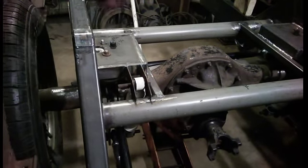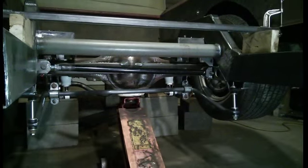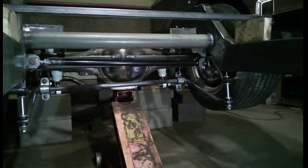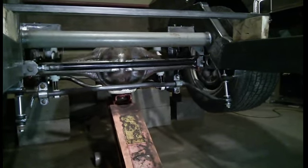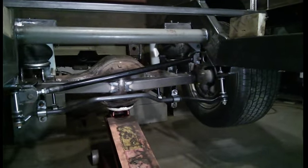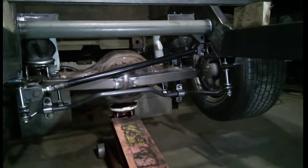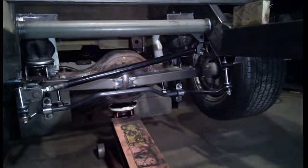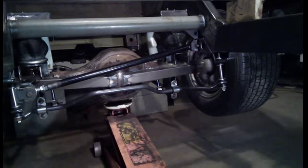So I'm going to have to do some more work. That'll all get cut — same with over there. I'm just checking clearances on everything with the rear end all the way up, then I let it down. I had two inches of up travel and short of four inches down travel — about three and three-quarter inches. The most I'm allowed to stretch that bag is nine inches, and it's at eight and three-quarter right now, with the shocks holding it from going any farther down.